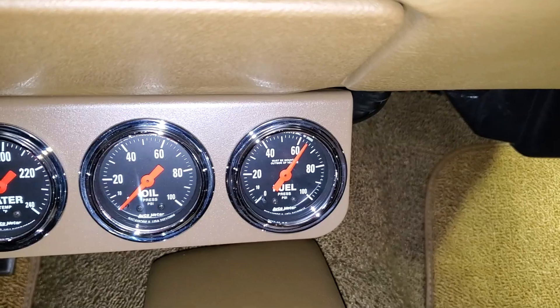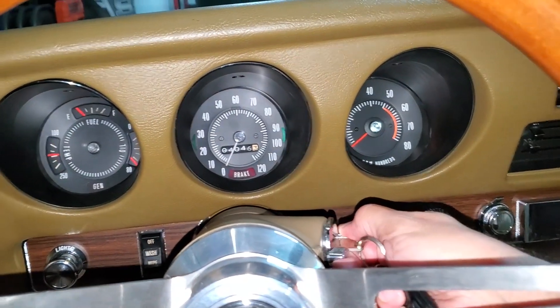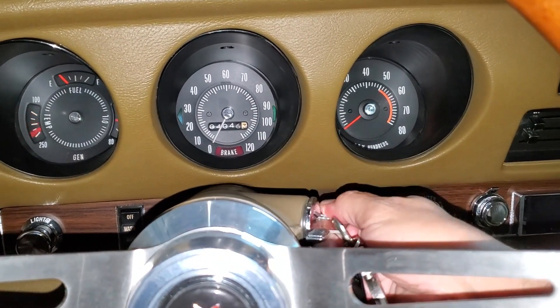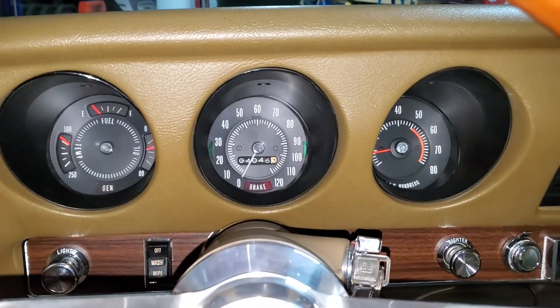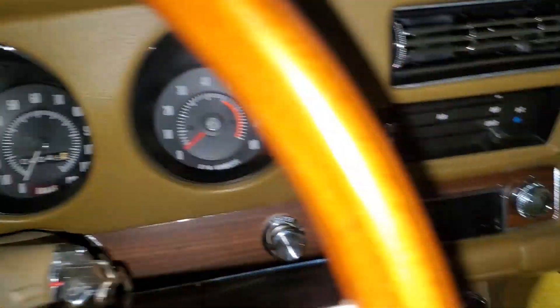So I'm keyed on. I haven't done anything yet, but I have fuel pressure from my new gauges. Here's what happened — this is the first attempt to turn the engine over. Notice it just cranks and cranks. It probably takes me two or three times. It starts to sputter. I'll key off again. I can hear the throttle body squirt. And then it finally starts. Now it should be starting faster. The unit is powering the distributor, so there's enough squirt going on from the throttle body — that was three squirts. It got enough fuel to kick the engine, and then the computer caught up to it.